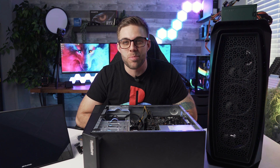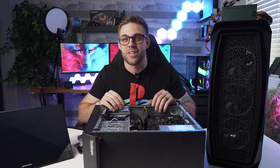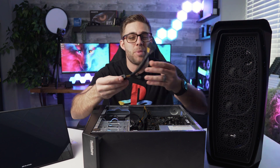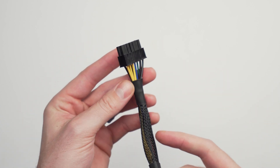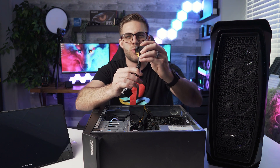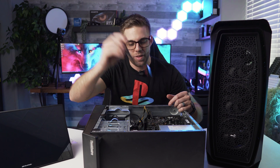Before we start tearing things apart, I want to clear up a few things you're gonna need to make this swap possible. One of the things you may want to do is upgrade the power supply, because you may want to use a higher wattage graphics card. What you're gonna need is one of these adapters - very cheap, available on eBay or Amazon. It converts the normal 24-pin on a power supply to the proprietary 14-pin on this motherboard, so it's a 24 to 14 pin adapter for the M93P.